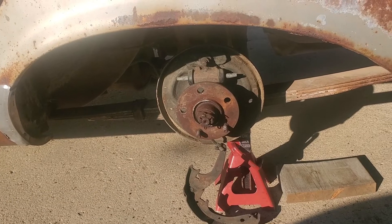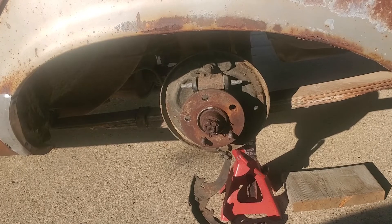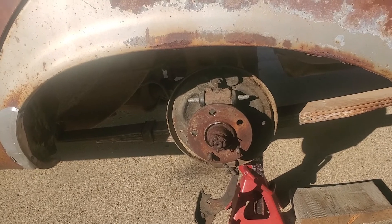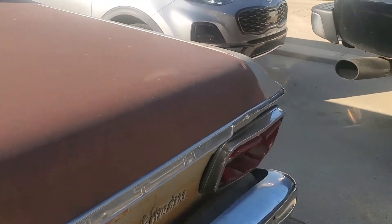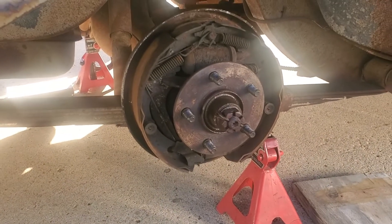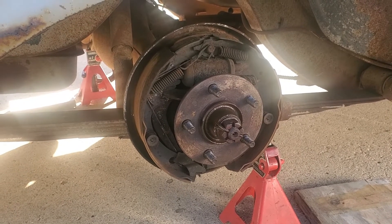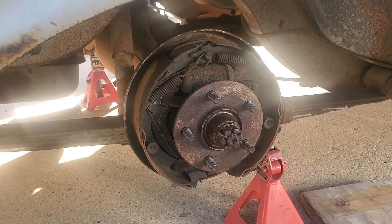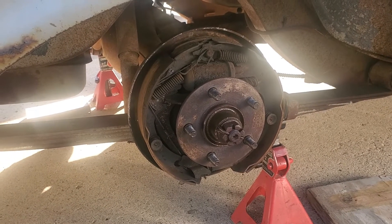I started doing the back brakes on the car. This side took about 45 minutes to get the drum off — it was seized on, but not too bad. I have new studs coming for this side and got all new lug nuts for all the way around. The other side was a real challenge — took about two to three hours, it was on there solid. Finally managed to get it off but broke both drums in the process, so I now have two new drums. I also have new brake cylinders, new brake shoes, new spring kits and hardware kits for the back, which I'll be installing later this week.